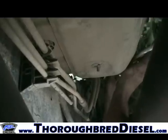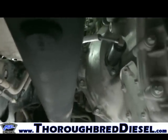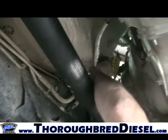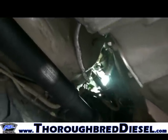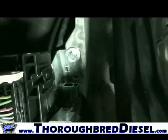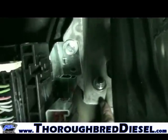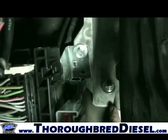I'm just going to get a gauge on where I need to be. That's where I want it — right there because that's the only place where it's not kinked. We zip-tie it right to one of the brake lines and we've got it. Now we're going to tighten up both the 15-metric bolts — there's one right above this and just to the right. We're going to re-hook our electrical connection for the neutral safety switch and then we're going to adjust our rod.